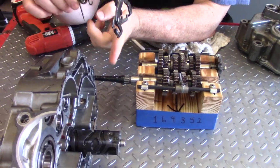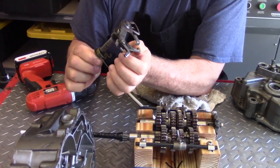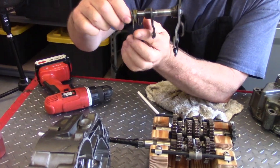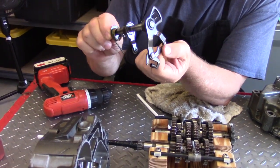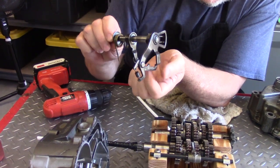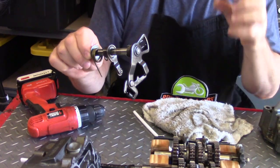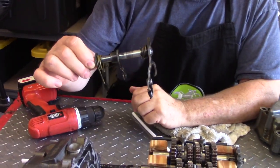The shift drum is turned by this ratchet mechanism. This ratchet actually comes on the outside, and as we turn it, we're moving it one notch. We let it go, we move it again — it's actually turning. This controls the movement of a gear up one or down one. This is the shift mechanism.